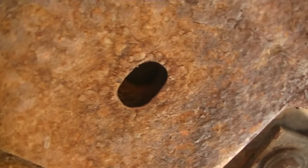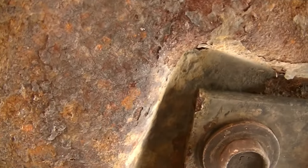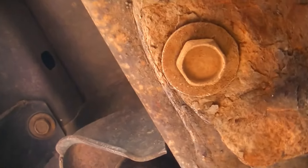We're at a point where we can start pulling some of these bolts out. Got my jack set up. Eventually once we get to the last bolts we're going to put the jack under here to support the tank. First thing we're going to do is take our 18 millimeter socket and remove bolts one, two, three, and loosen the fourth one — basically pivot this thing out of the way so it will clear the fuel tank. Then we start removing the fuel tank skid plate bolts. There's one here, one here, two up here, one by the crossmember — you'll probably need a swivel for that — one over by the drive shaft, and one in the back.